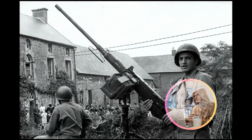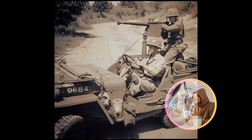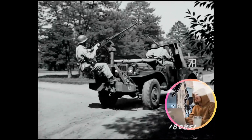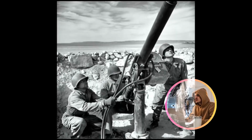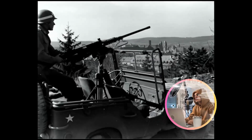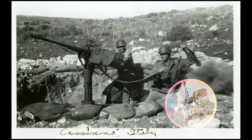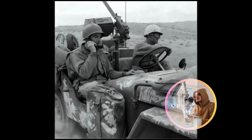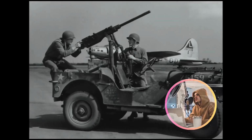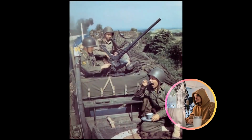For instance, the gun trucks belonging to the 523rd Transportation Company utilized readily available automotive coil springs. In contrast, the 8th Transportation Group favored robust aircraft shock struts for their isolation systems. Meanwhile, the 39th Transportation Battalion engineered mounts incorporating rubber torsion elements ingeniously salvaged from helicopter landing gear. Despite these varied implementations, they all adhered to the identical foundational principle. It was imperative to isolate the weapon from the vehicle's inherent vibrations, or else resign oneself to drastically impaired accuracy.